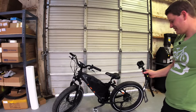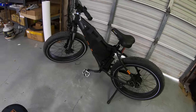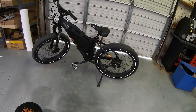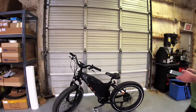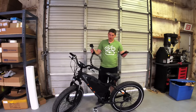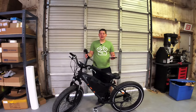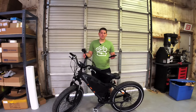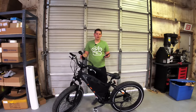So there you go — you can see that's not very difficult at all; it's actually very easy to do. We have upgraded that bike in just a few minutes from the stock 48 volt 14 amp hour battery to a 52 volt 20 amp hour. So 48 volts times 14 amp hours is 672 watt hours for the stock battery that we removed. And 52 volts times 20 amp hours is just over 1 kilowatt hour of battery — a substantial improvement. Because we increased voltage, we're going to see a slight bump in top speed, and then we're going to see a huge improvement in our overall range.